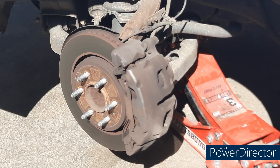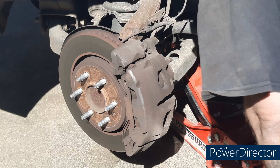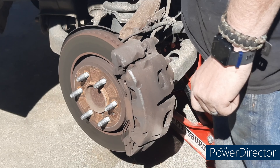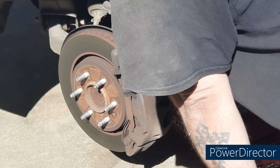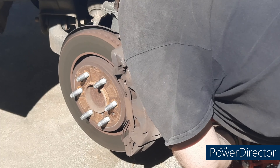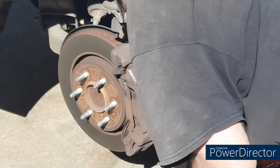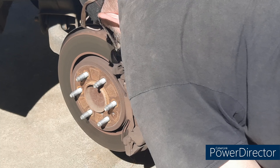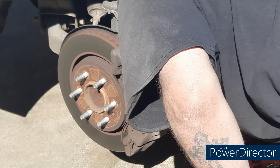Now that you've got your wheel off, got it jacked and secured, you're going to get your 19 millimeter. There's a plastic cap on the top and a plastic cap down on the bottom — you'll pop those caps off. Then you'll get your 19 on the breaker bar and go ahead and break that loose. Then you can switch to a ratchet. That side was already kind of loose, and that one right here feels kind of loose too.